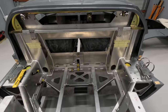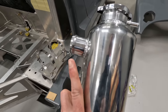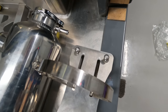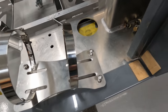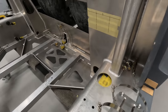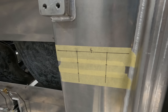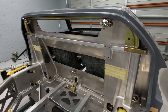Something dawned on me as I was getting ready - this header tank has its inlet on the side, which became a problem with the bracket because it sits right where the stainless steel clamp goes to hold the bottle to the bracket. So I've had to extend the length of those slots so I can get that hose clamp low enough to wrap around just underneath that fitting. That's also changed the height I want to mount the bottle at - I tried one inch and two inches lower than originally marked, and I'm going to run with one inch below where I previously was.